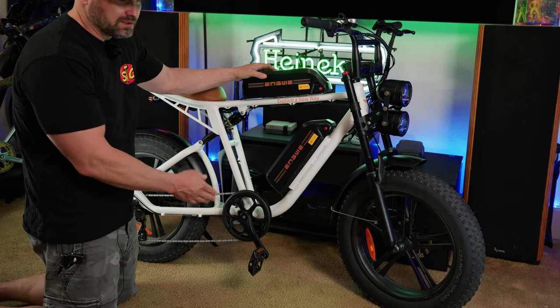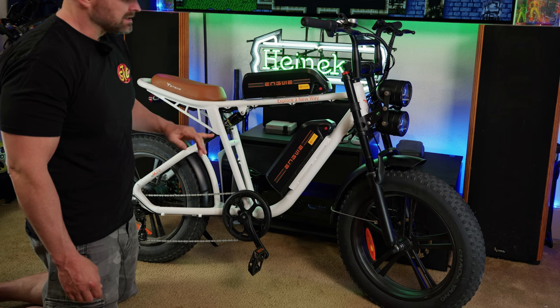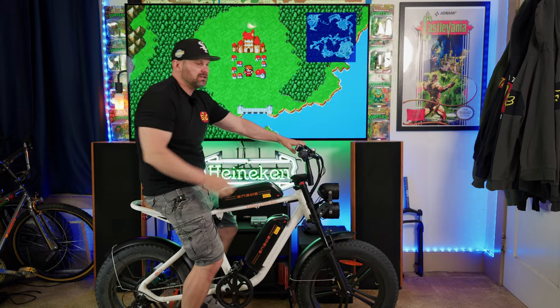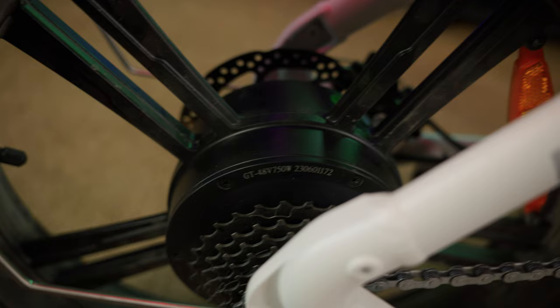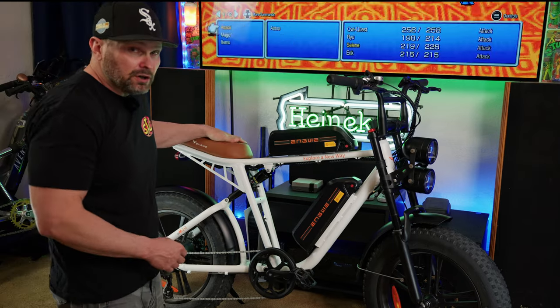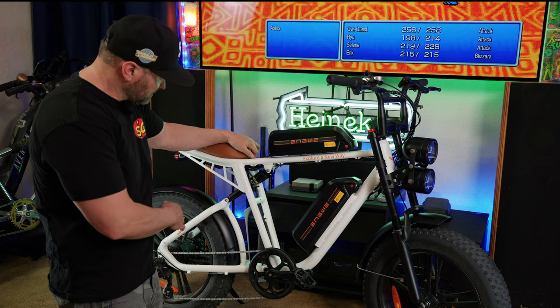These black Welgo pedals that come on a lot of e-bikes are pretty nice. It has front and rear suspension — the front has compression adjustment, and the back uses an HLT 100 shock that is not adjustable. I'm 240 pounds and you can see it doesn't move very much, so I'm not really fond of the fact that you can't adjust the rear shock. The rear has a 750-watt hub motor integrated into the mag wheel, and underneath the seat is a 48-volt, 20-amp controller — putting out just shy of 1,000 watts peak.